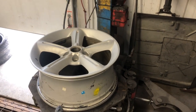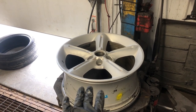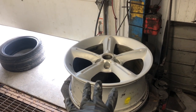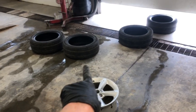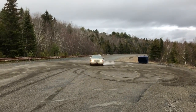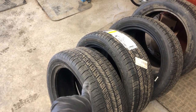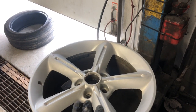What we've got is some 18-inch Mustang rims off of an '11 Mustang, and they fit right on the Panther platforms - at least my '04 - with absolutely no modifications, no wheel spacers, nothing. We're scuffing them up and getting ready to add a coat of paint without priming, because we want the silver to be the base. We do have some Goodyears going on today - these are 245/45/18 Eagle RSA.